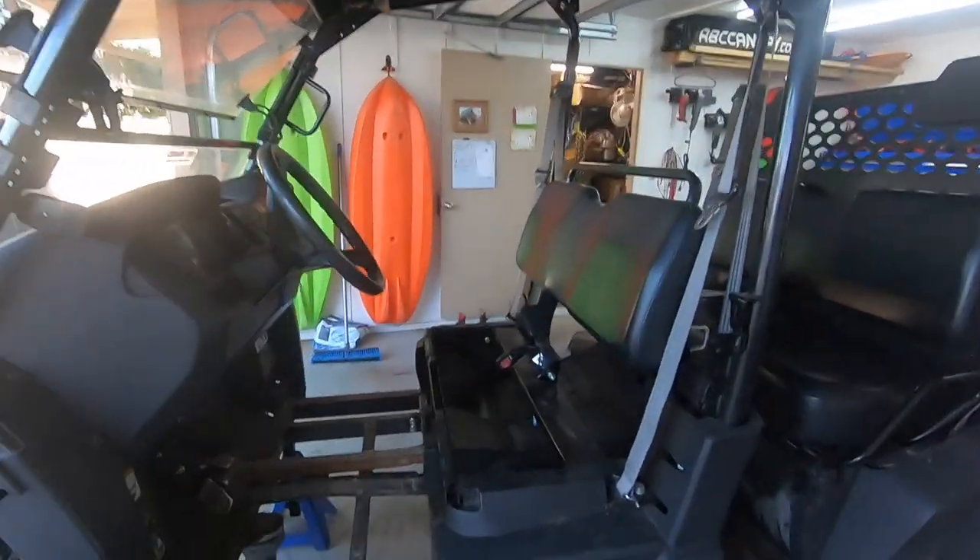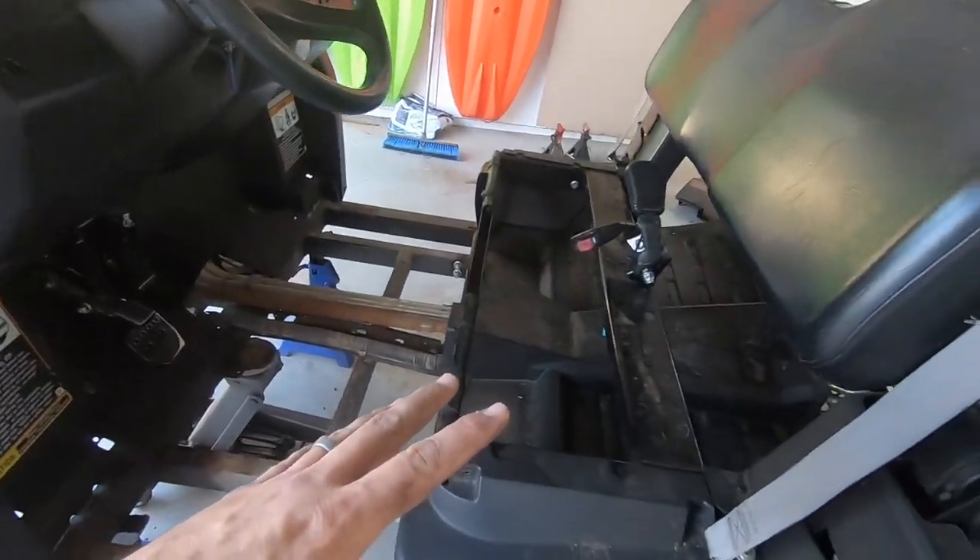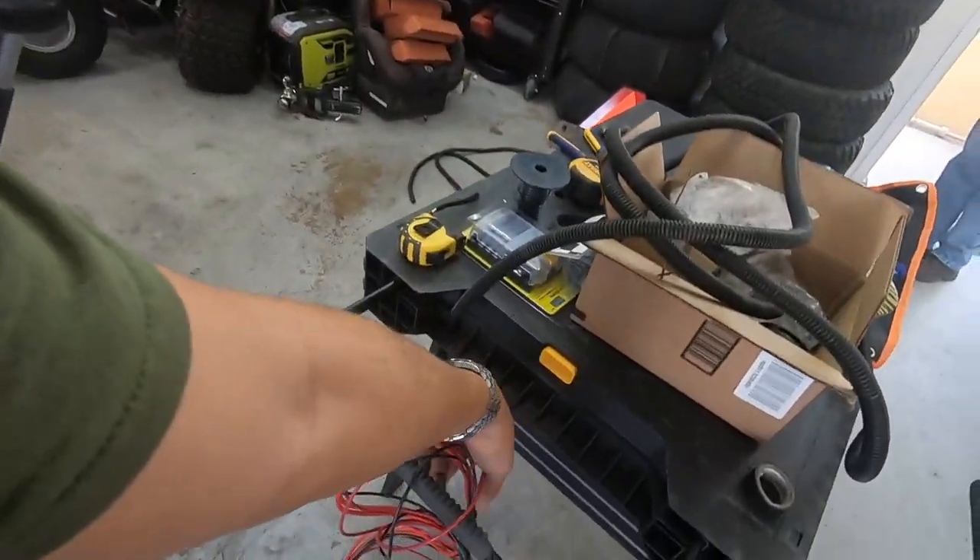Let me give you an update of where I'm at. I'm not doing as much filming on this one because there are just so many bolts coming out of this thing. I got the front out and I've measured the wire loom — here is my bundle of wires. The way I'm working it is I have a voltmeter going up here and then three switches: one for front lights, one for rear lights, and one for the pump for the sprayer. Each switch needs a ground which I can daisy chain off each other.